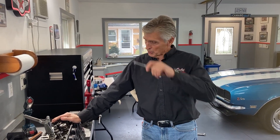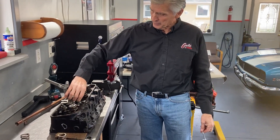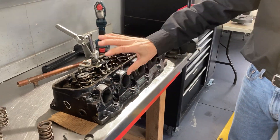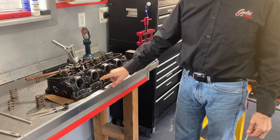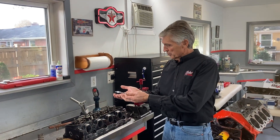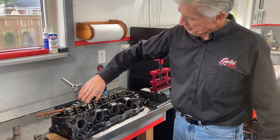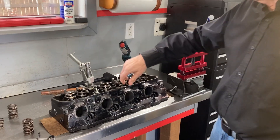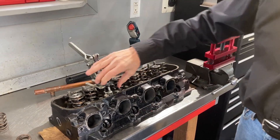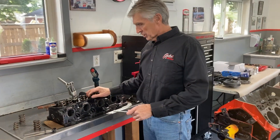What we're trying to determine here to start with is what is the installed height force. I'm pulling this spring up. If this head was on an engine, it would actually be easier — you could put air into the cylinder, lock the engine from rotating, put pressure on the bottom of the valves, and that would hold the valve up tight against the seat. We have to hold it up ourselves. When I go to compress the spring, sometimes the valve wants to move, which makes it a little bit more awkward, but it's workable. I do heads like this all the time.